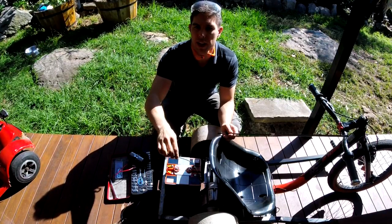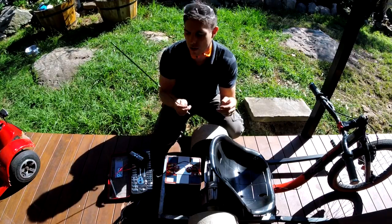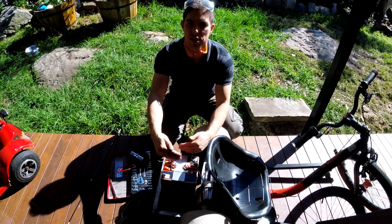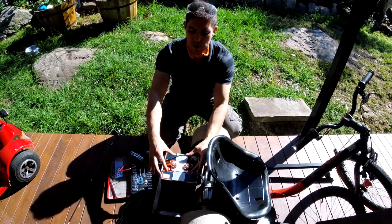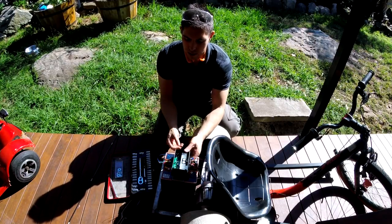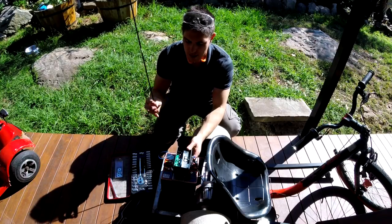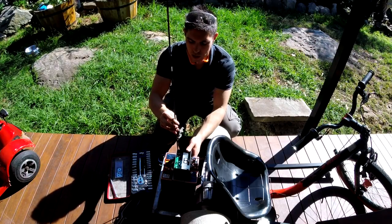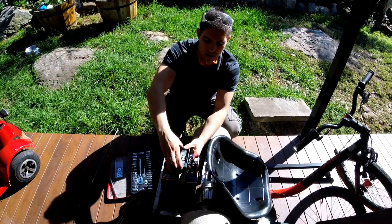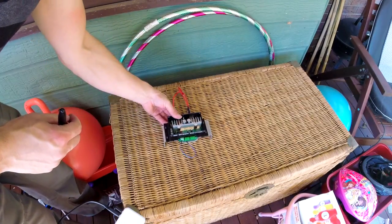I've mounted the new throttle and routed the cable at the back. It's very important to make sure it's not at the low points of the frame — otherwise, if you bottom out, cable wires are destroyed and repairs are needed. I've got my brace from the last episode; I've actually shortened the centerpiece to move it away from the terminals. Previously I had the battery switched position so the terminals are on the outside, but this time I've got them on the inside — it was a little bit too close for comfort, so that's a safety modification. I'm planning to mount my speed controller directly on top here, but the problem is it'll block the wing nuts that take off the battery clamp. So what I'm going to do is get some carbon fiber to use as standoffs, then have some M4 screws that go through and tap the thread into here. That way I put this above, standoffs underneath, screw it down — it'll be held nice and firm but I can still remove it if I need to take off this section.